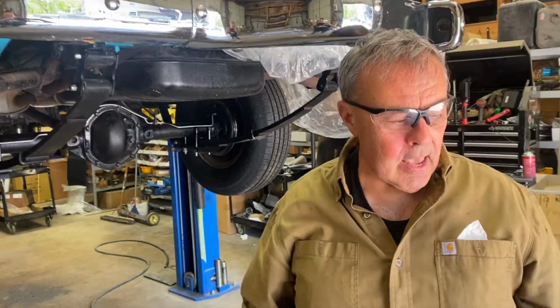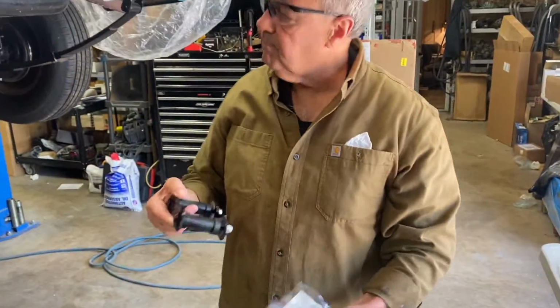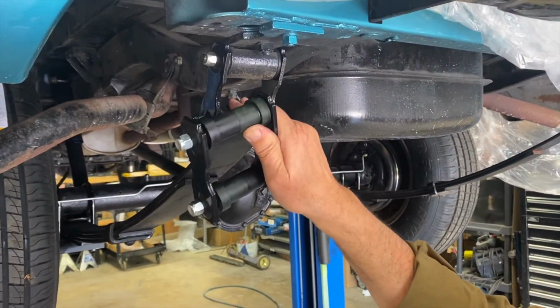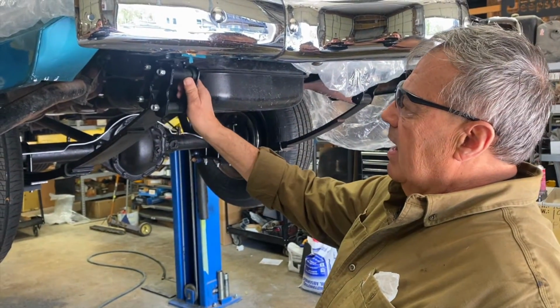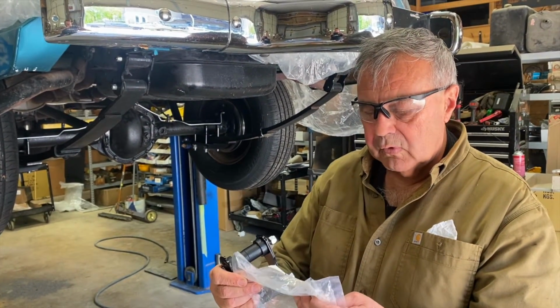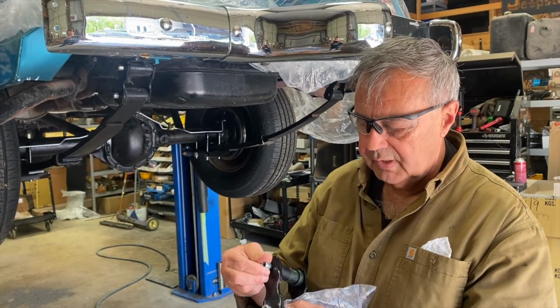So we sell a kit, and this kit, you can see it right here, it's actually a direct replacement for a 2.5 inch wide rear spring. This happens to be a 67 Jeepster Commando, but this fits pretty much any 2.5 inch wide on the Jeepster. So part number is 5357499K, and the K stands for kit because it comes in a complete kit.